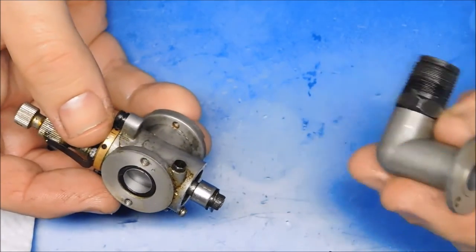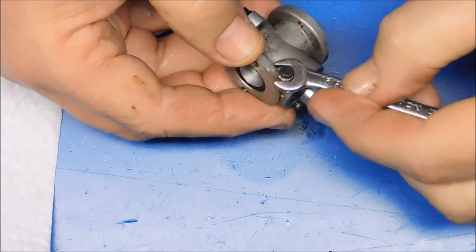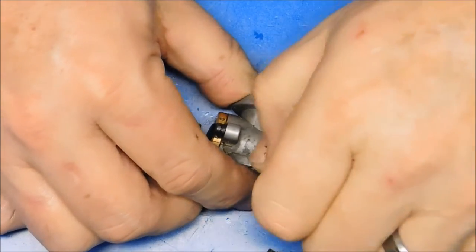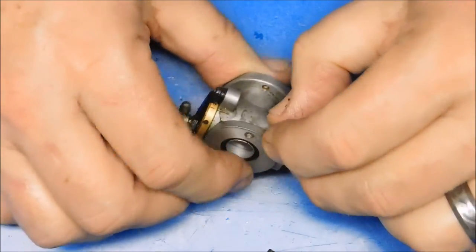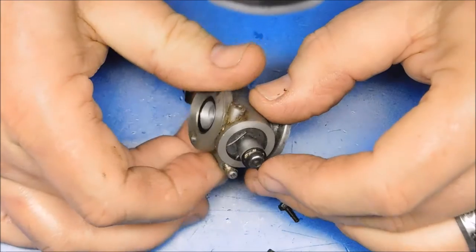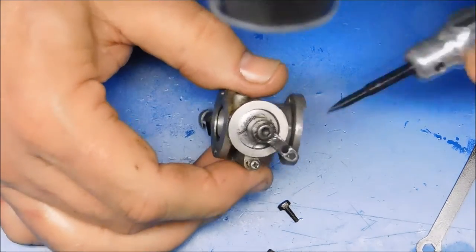This carb body may need to go in the cleaner — there's a lot of crud. I'm going to have to find a really small wrench for this; that one's way too big. Luckily I've got one of these Sato spanners. Removing this should allow this to come out, except it looks like there's a retaining clip in there, which I had not anticipated.